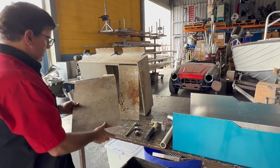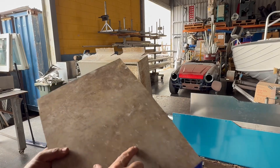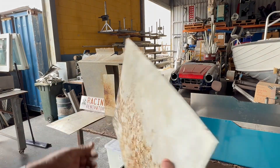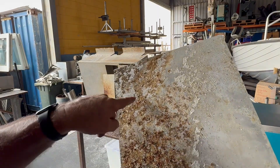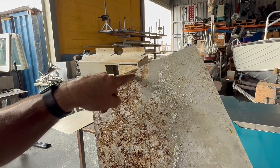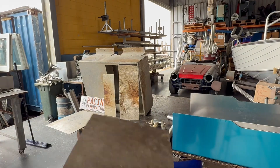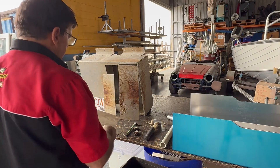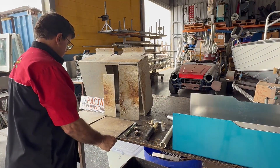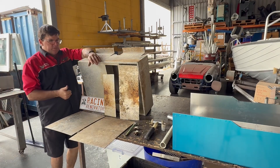Here we cut the tank out — there are more holes in it. This one here doesn't look like it's got any holes, just the beginnings of little pinholes, but inside you can see big craters that have been eaten into it. It's only a matter of time before one of those comes through and becomes a pinhole letting water in — it needs to be repaired.